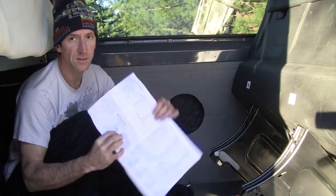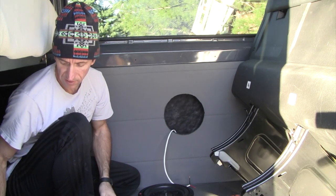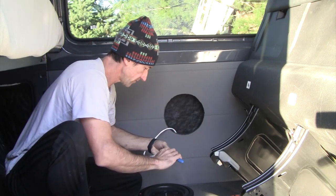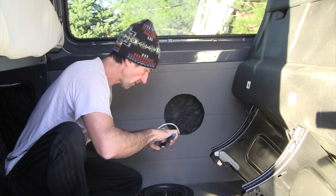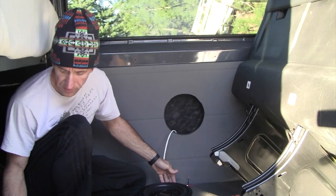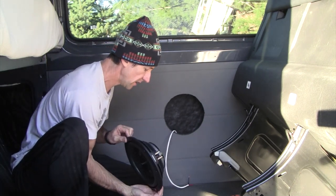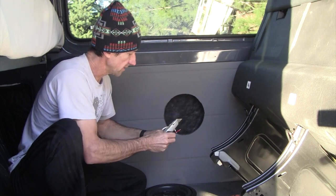Now to do that, there's some wiring diagrams that come in the manual. So for the 4 ohm load, what we want to do is take positive and negative wires here. Alright, so to run this as a 4 ohm, we just need to connect the positive and negative on opposite sides to our feed, and then we're gonna jumper the other two positive and negative cables together.